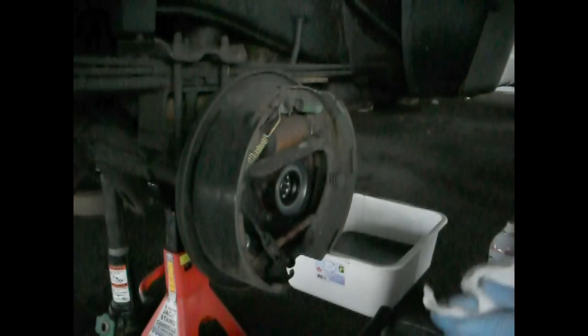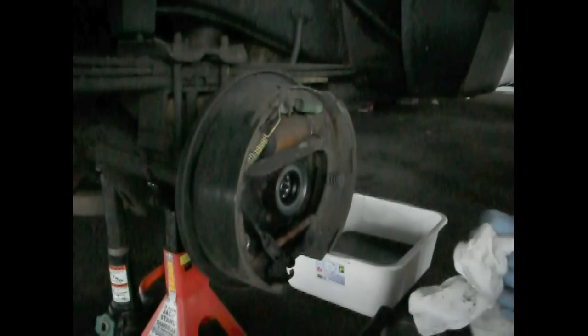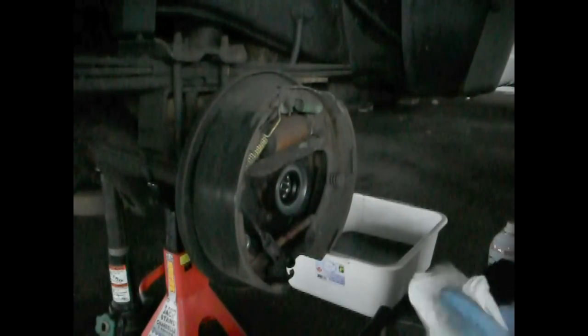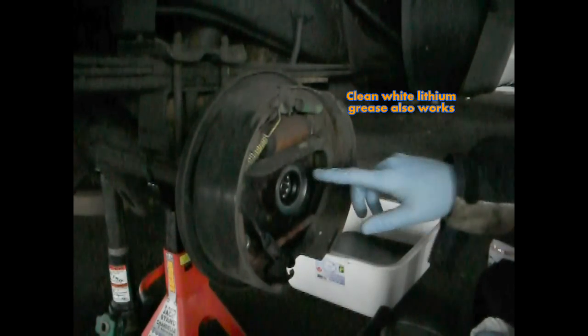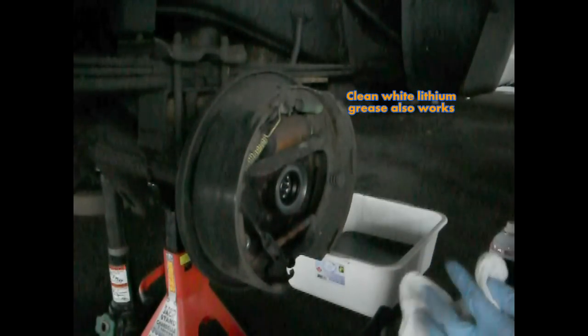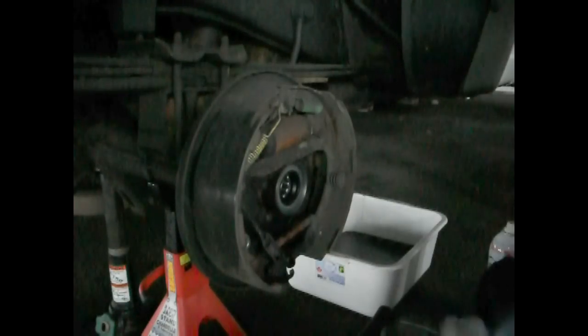That's it though. Now you just clean up any of the extra sealant sticking all over the place where it's not supposed to be. And put a little bit more gear oil in around your seal area. That way when you put the shaft in, it's nice and lubricated already around the seal. And that's it. Fill up your differential and stuff with fluid.